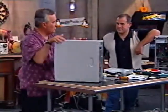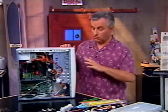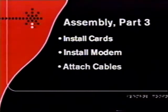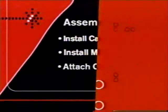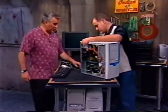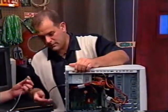Now that we've got all the parts together, it's almost time to plug these babies in and start them up. Follow along with us at techtv.com slash buildapc. Coming up next, we're going to show you how to plug in, boot up, configure your BIOS, and troubleshoot if things don't go exactly as planned. We've got our mouse and keyboard, our power supply, our network interface. The keyboard goes right into the keyboard connection there — these are actually color-coded: green for the mouse, purple for the keyboard. One of the disadvantages of making your own PC is sometimes you don't have that labeling.